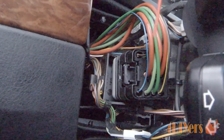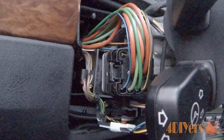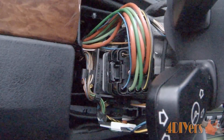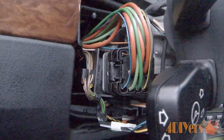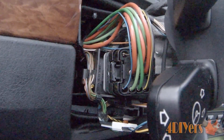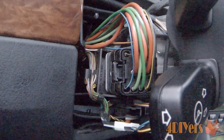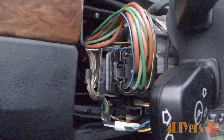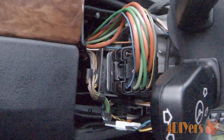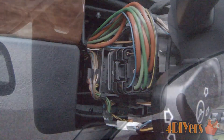I will also include a tutorial on how to repair this switch if you do have faults. Other issues you may experience with a faulty ignition switch include your radio not working properly, lights on your dash such as the check engine light or ABS lights, gauges not working, or headlights not working. There are a lot of different issues you may experience. You might also experience a battery drain — say you turn your vehicle off, leave it parked for a couple of days, and come back to a flat battery. There is a short in the switch causing a consistent draw on the battery.